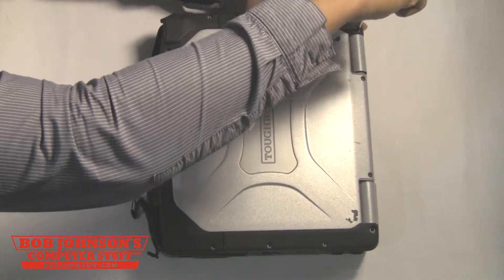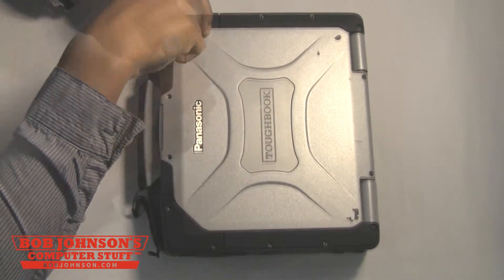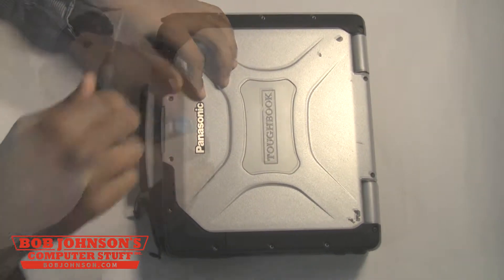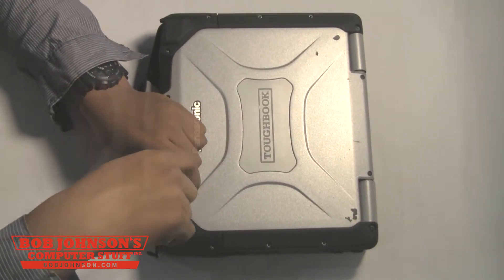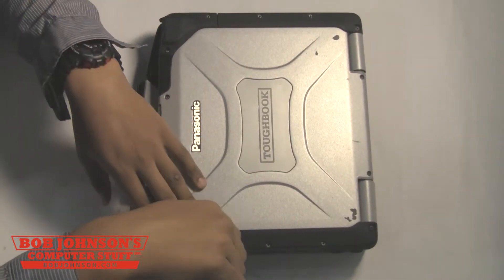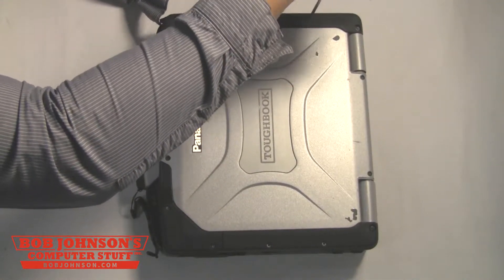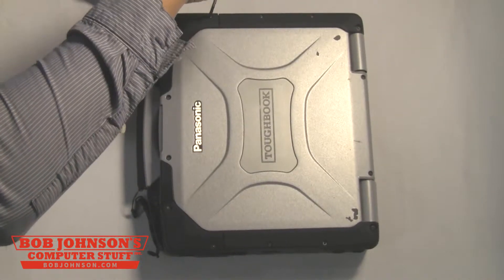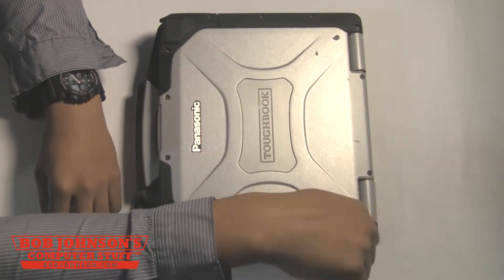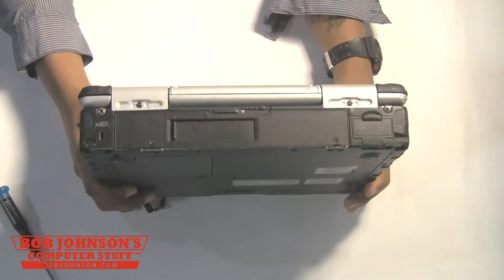You may have to do a little bit of adjustment with the hinge covers. Next, replace each screw for the top bezel, starting with the large screws closest to the hinge covers, then work your way around the top bezel replacing each of the screws. There are also 14 screws that need to be replaced for the top bezel, so be sure to keep track of all of these screws and make sure that you're using the appropriate size. Next, we're going to replace the rear screws for the hinge covers — there are two screws for those hinge covers.